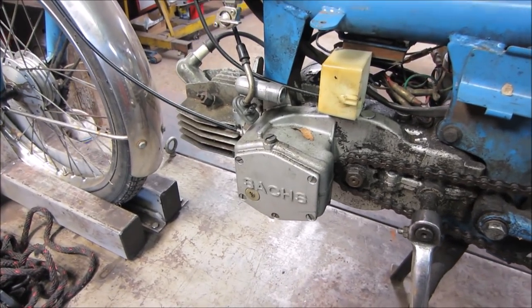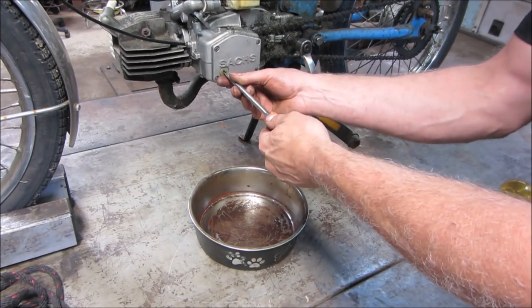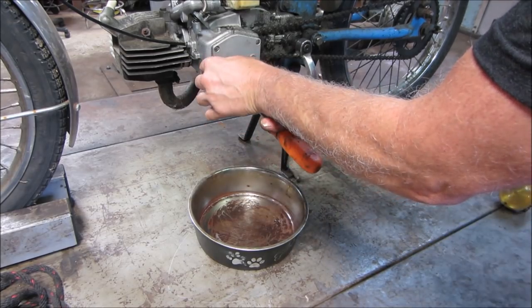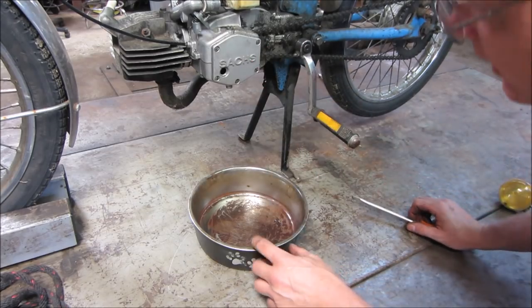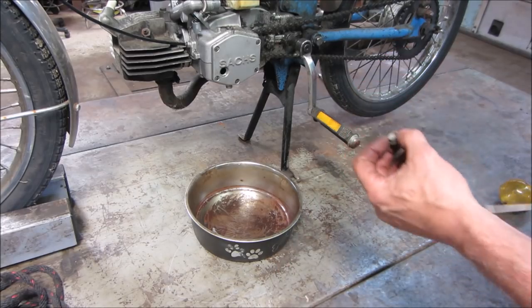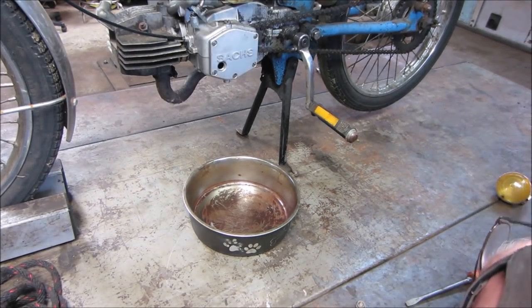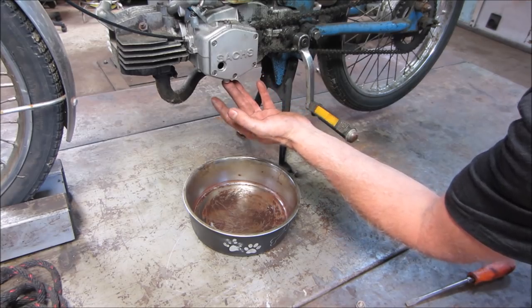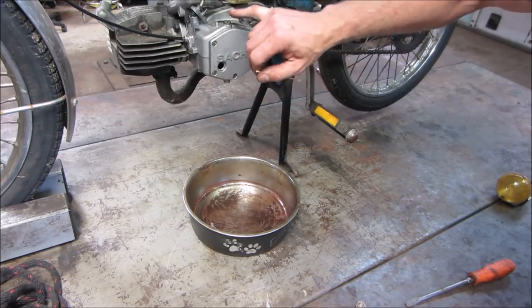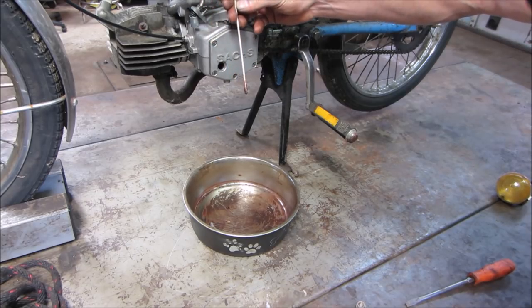I can bring it out with a pressure washer and pressure wash it. Hope my dog doesn't want his dog dish back. Gotta look up what goes in it. Well, that's a tad dry. Not saying that it's supposed to have fluid in there, but I would think it would, wouldn't you? Let's go look around. It might be another area of the gear case that takes some fluid. That would be a drain. That's solid across. Let's probe it. That might be the fill line that's supposed to be filled to, and then it runs out. I would say that's where you fill it. Let's just see if there's, yeah, there's oil in it. Pretty dark, but there's oil in it.